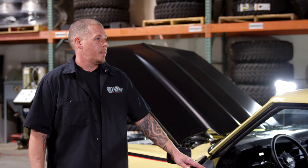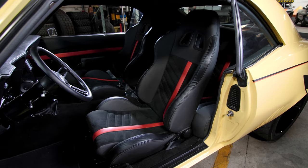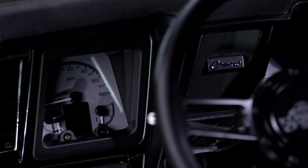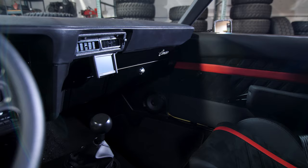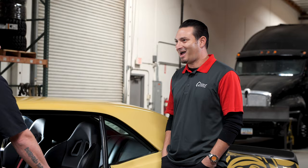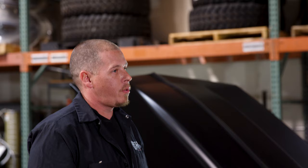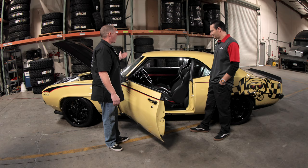I love the mix of textures in the interior — there's suede, there's some leather, there's a little bit of red in there to tie it all in. This must've been custom. Yeah, absolutely — a one-off interior for this vehicle. The gauges look like they're really dialing you in. Those are the Dakota Digital gauges, so we get a much better and more accurate reading than your factory gauges would have for this LS motor. It's just a Cat 5 ethernet cable that goes right to their brain — probably the easiest gauges to install. It's not so crowded and cluttered behind the dash.